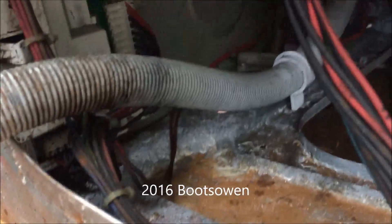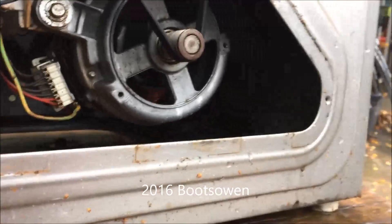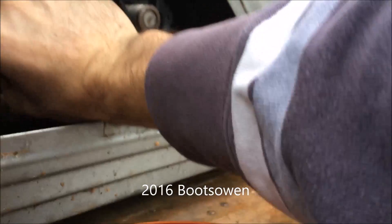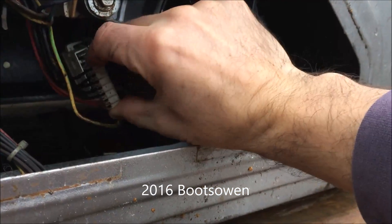So it's pretty grimy inside. The bearings have failed — that's where that brown sludgy water has come from. This is the motor here. The connector is in place, so it should just be a matter of unclipping this thing here. Get the earth cable off first, then pull this off. Sometimes it has a clip. It just slots out like that — just pulled it straight out.